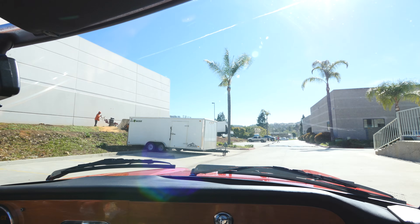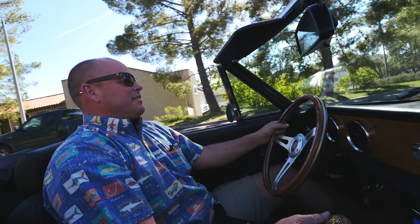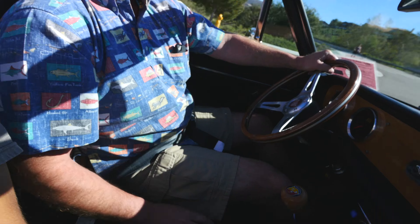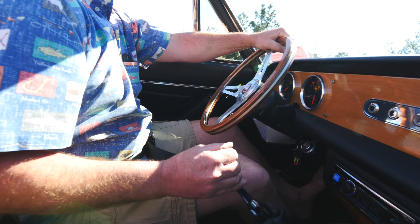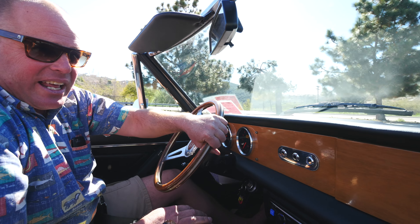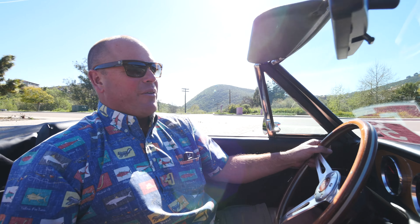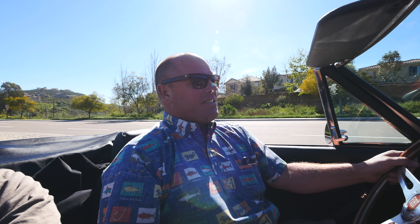Wow. Second gear start — 176 horsepower. The brake kicks in. We don't have a vacuum pump on this because the brakes without the regen are a little bit heavy, but when we put the vacuum pump on it'll add too much brake. We'd rather use the regen to extend the efficiency of the car, give it more range. Anytime you can brake and put energy back into the batteries, that's what you want to do.